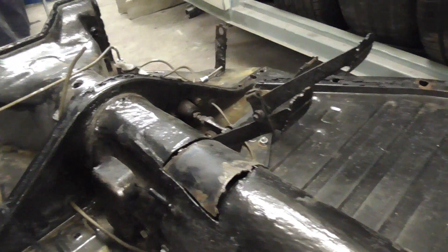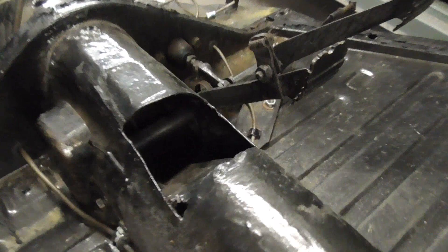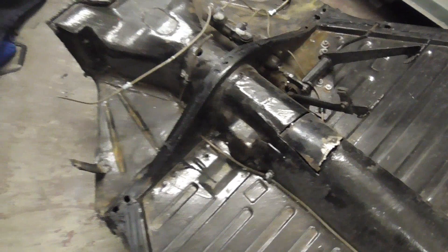Up the front, I think the pan's a left-hand drive pan that's been converted at some point, so the pedals are a little bit interesting. I don't think there's a stop plate to stop them falling forwards, so we're going to have to sort something out there. I'm not quite sure what's going on here — that's a bit of a horrible mess, that's going to have to be sorted out and go back on properly. I suspect that's because they've moved the clutch cable over inside the tunnel.